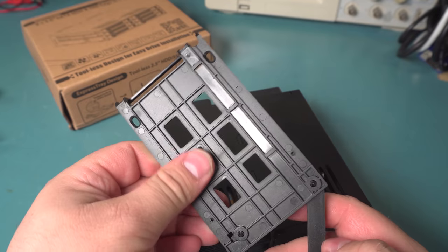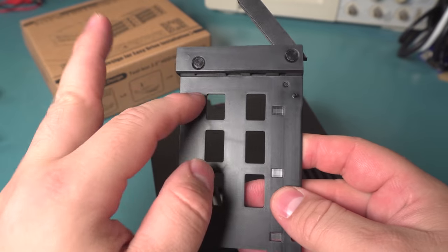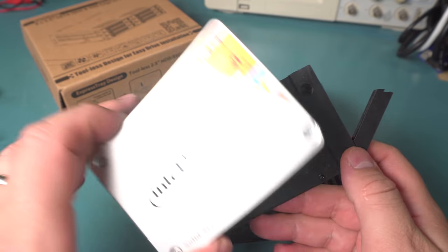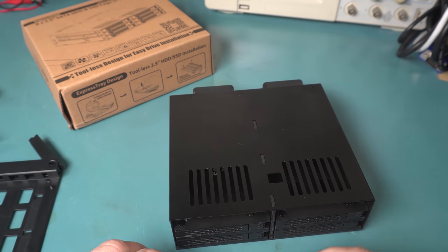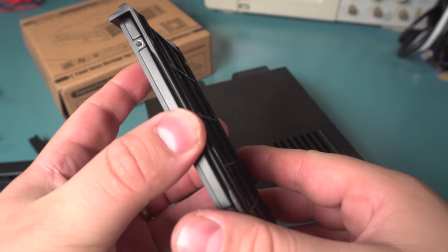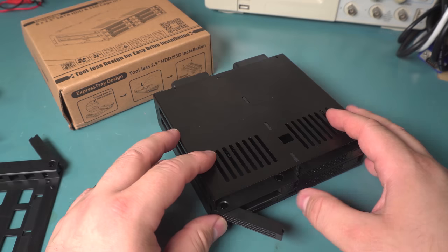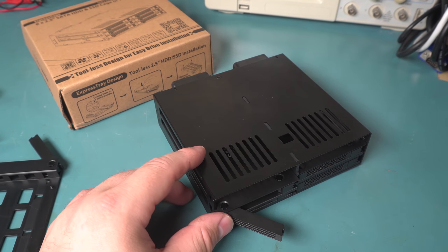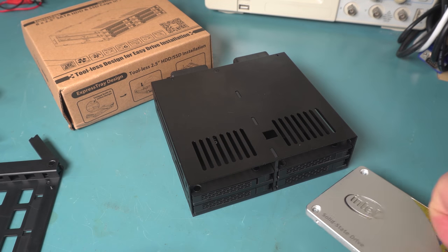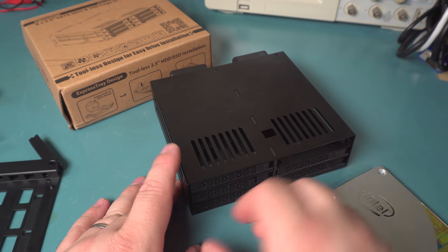The unit uses these plastic caddies that work reasonably well. They have a nice spring action and are completely passive — they only have a light pipe on them, there's no actual interconnect. The drive simply mounts inside it. There are two plastic pins for alignment on one end, and the other side uses a couple of screws. It includes screws for all six drives. Once attached, they're reasonably sturdy. If you're in a hurry and don't want to mount with screws, they do actually mount with just the pins, though they can get a little misaligned.